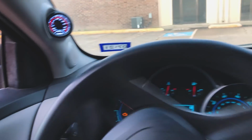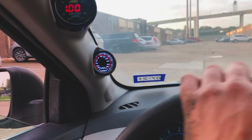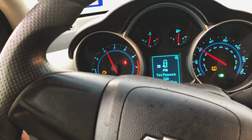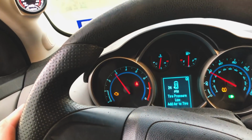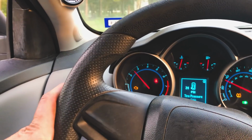We got a lot taken care of in this video. We installed the engine, got the turbo system all set up, and fired it up for the first time. We let it run at varying RPMs and even took it for a first drive just to put the engine under load to seal those piston rings up. We brought the engine up to about three to four grand and did some engine braking, in other words, letting the engine slow the car down, to really seal those piston rings up and get about our first 20 minutes worth of run time.